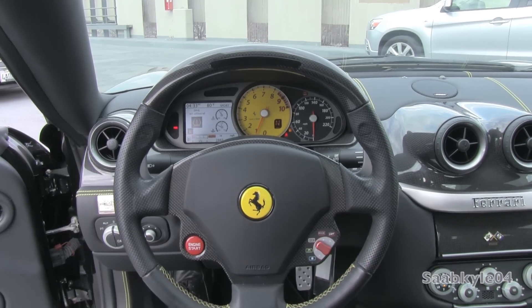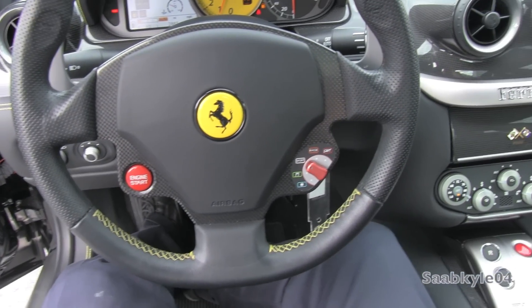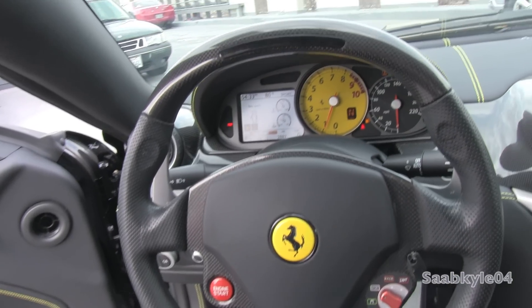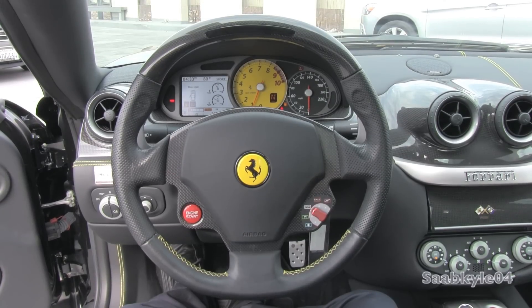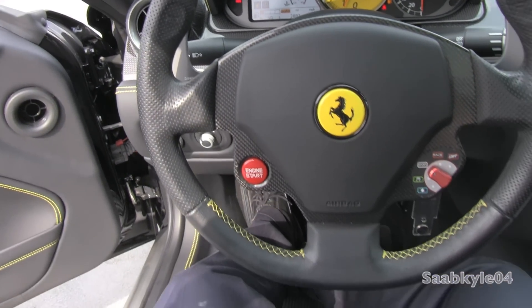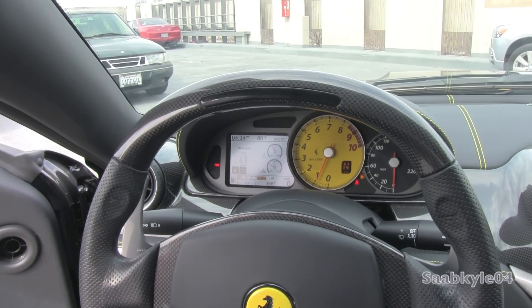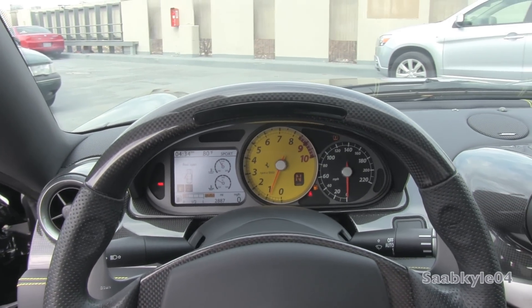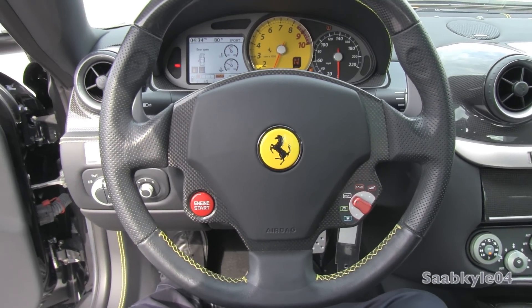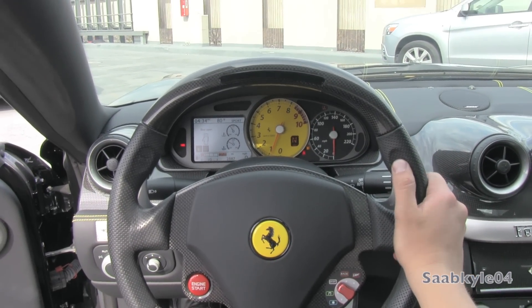The 599 carries a hydraulically-assisted rack and pinion steering setup fed through a three-spoke leather and optional carbon fiber steering wheel. Perforated leather wraps the sides, while the smooth bottom features optional color accent cross-stitching. There are comfortable thumb rests at 9 to 3, while 10 to 2 houses robust bolsters for extra grip. Each bolster also houses a button for the horn. The carbon fiber portion at the top contains a strip of LEDs that sync up with the tachometer to indicate proper shifting intervals like an F1 car. The Manettino switch in the bottom right alters everything from shifting profiles to stability, F1 track, and even the adaptive dampers, adjusting accordingly in either ICE or race mode.